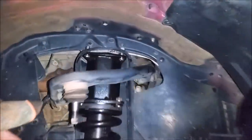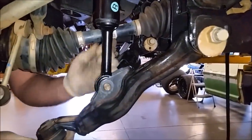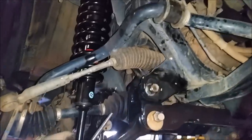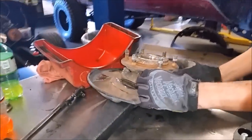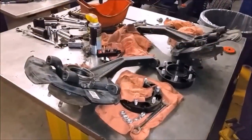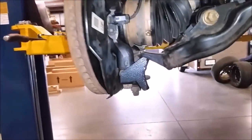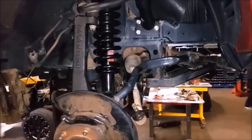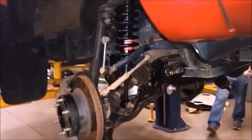So now we're reinstalling the new strut — I've gone ahead and put a nut up there just to hold it — and now we're positioning the strut back into the lower control arm. We're now putting the hub assembly back on the new knuckle with four bolts right down there to hold it on. With the Rough Country knuckles attached to the OEM hub, we're now ready to reinstall these onto the truck. The knuckle is now bolted to the lower control arm. We have already installed the steering stop brackets on both sides of the truck. Now we just need to reattach the sway bar end link and the tie rod end, and the upper control arm is already reattached. With everything reattached, we now have the brake caliper and disc brake along with the wheel spacer back on. Now we just need to reattach the sway bar bracket to the new mounting brackets.